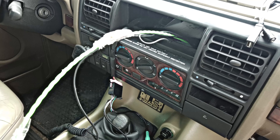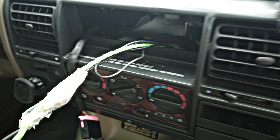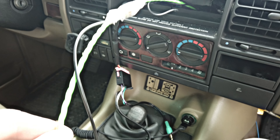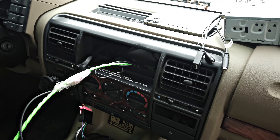No easy task — I was able to get the fish tape up through here to the head unit. There is very, very little space back in here; just a tiny little opening that I was able to get the cables for the under-seat subwoofer through. This is definitely the hardest part. I'm pretty glad I'm not fishing multiple speaker wires through this section because there really aren't a ton of openings. The easiest way to find where to route is to just follow some of the existing factory cables — antenna cables and things like that — and look inside to determine where they come up. Use your fish tape and go slowly; you don't want to rip any cables. Got the subwoofer cable through, so we'll get all this cleaned up, get the Bremen head unit in, and then work on wiring the power for the subwoofer.